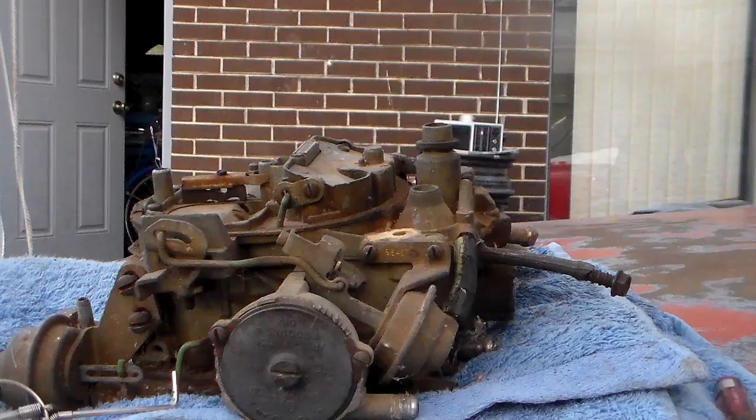Hey guys, how's it going? You've probably noticed by now that I have a lot of quadrajet videos on my channel. I've tried to do several videos showing people how to adjust them and use them and enjoy them and get them to run better. People have had a lot of bad luck with quadrajets and I think they've gotten a bad rap. They aren't hard to get to run right and they're a very good carburetor - they have a lot of CFM capability combined with pretty good gas mileage because of their spread bore, so you kind of get the best of both worlds with them.